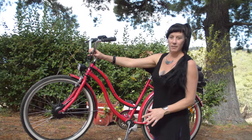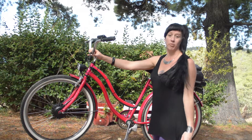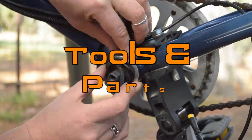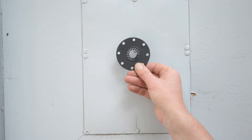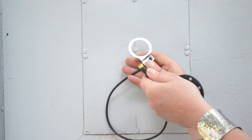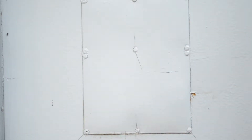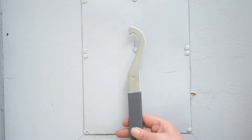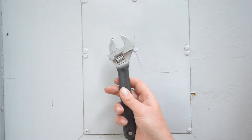Fitting one of these is a little different for every bike. We're going to show you the most straightforward regular type of bottom bracket with internal bearings components today. So let's leap in. The parts we'll be using: the magnetic disc, the sensor ring which runs to the controller, a 14mm socket, a crank extractor tool, a 15mm — preferably a spanner rather than a shifter — a lock ring tool, and just in case, a handy shifter.